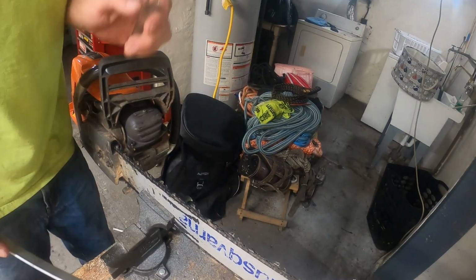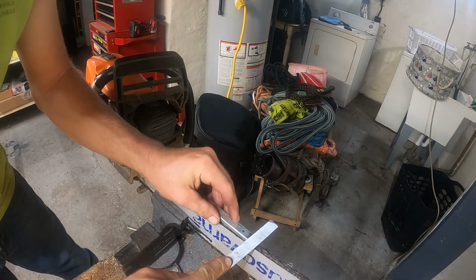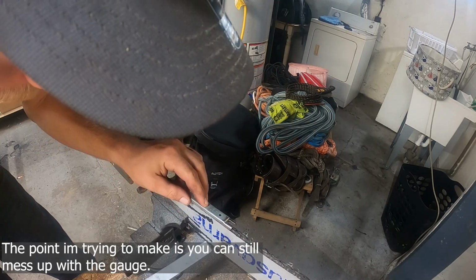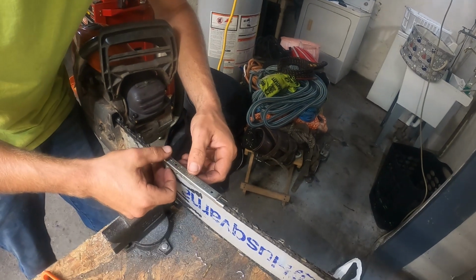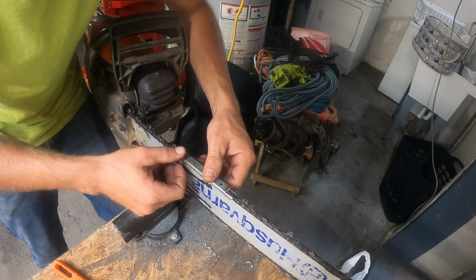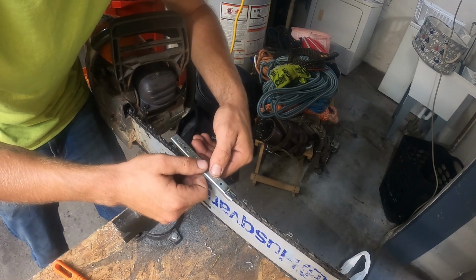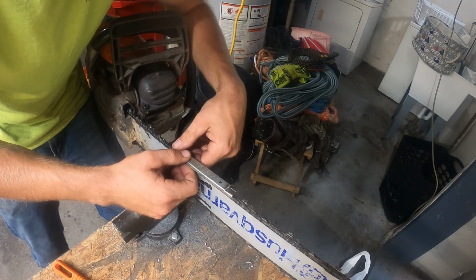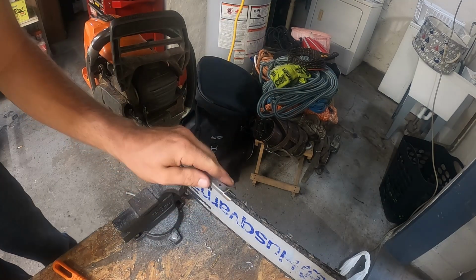It's like, I'll get in a hurry or whatever, and I'll start pushing on this, and then this ain't flat on there. I feel like I don't have it on there right. And I feel like this ain't even straight, because watch what happens when I push back here. It pops up on the front now. So it's like too far up, you're pushing down where you're taking the raker too low. Too far back, it comes up where you're not getting the raker. So you have to really have this on there perfectly flat.